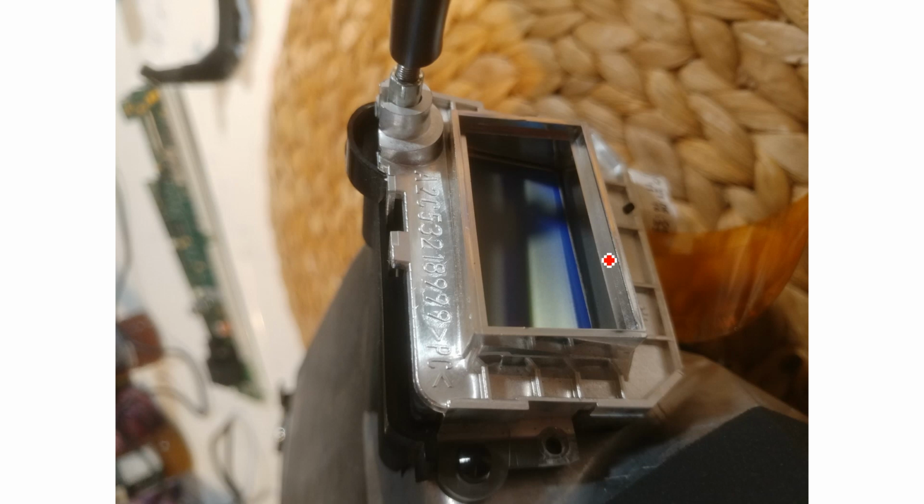Okay, so that more or less concludes the teardown as far as I went. Things that I didn't cover really are the mirrors inside the HUD, as well as possibly one of the circuit boards as well. But if you're looking to replace your shutter inside the HUD, it's pretty easy. I would just say be wary of dust getting in. Try to do it somewhere that's clean. Keep that top cover on. If there is dust inside it, you could maybe blow it out with compressed air, but I wouldn't recommend trying to wipe it.